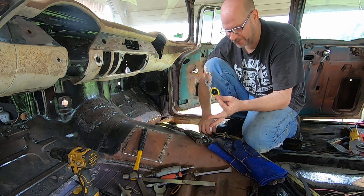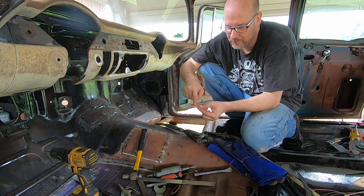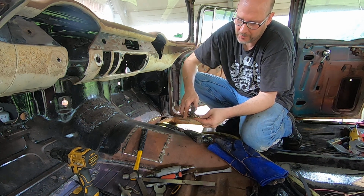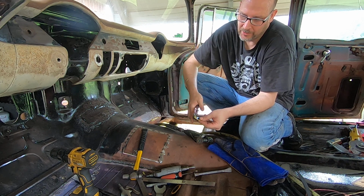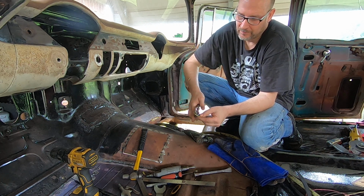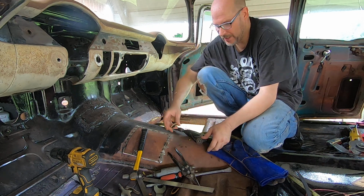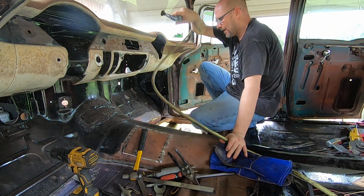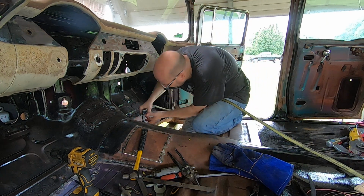And the other thing I like to do is normally the outer edge gets completely worn down. You still got some pretty rough stuff out here. I would go through here and cut this in a star pattern. Not a perfect star, just basically cutting off the old with a pair of tin snips here. Just like that. And I'll get a little bit more life out of these discs because a box of 25 pieces is about 30 bucks.